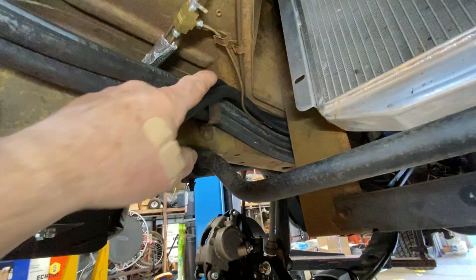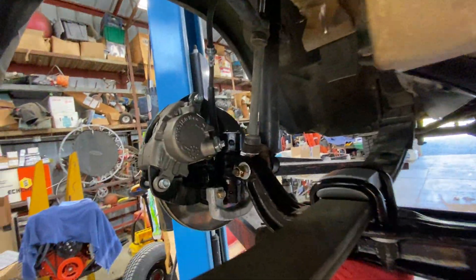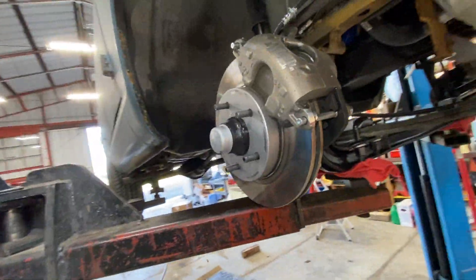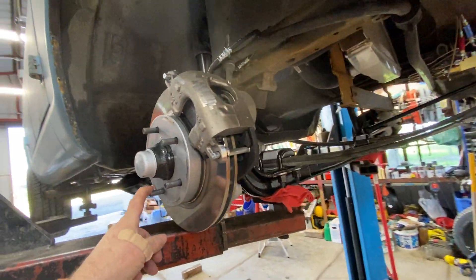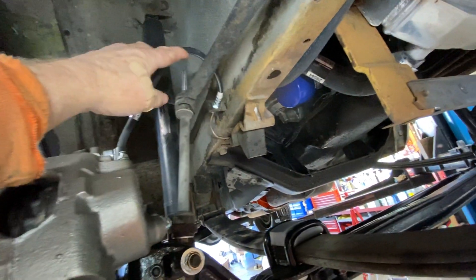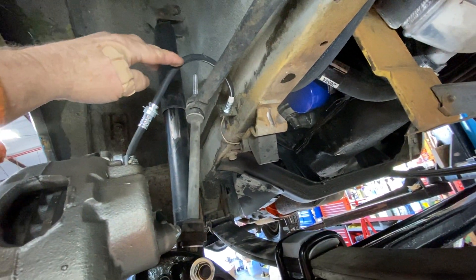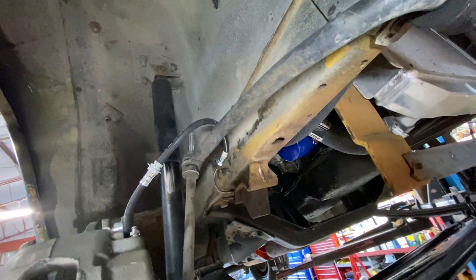With this power booster, we're only providing a power assist to the front disc brakes. We did replace all these brake lines, and of course new calipers, rotors, reuse the hubs, put in new studs — a little longer studs — and new rubber flexible brake lines. We still have to restrain that; it would be nice to have it a little bit farther away. We're trying a different routing — normally we'd go around the shock, but this seems to be okay.